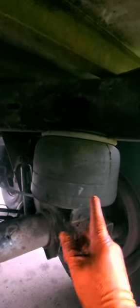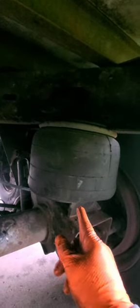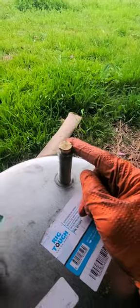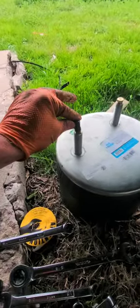We've got the nuts off the mounting bolts. You see you got one right at the bottom, then you got two on top — just like the new one. We got a plug on this stud. We're gonna push the fitting for the airline on this one. But first we got to get this old one out and get the new one in.